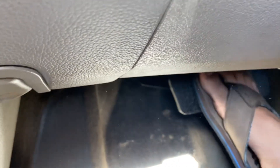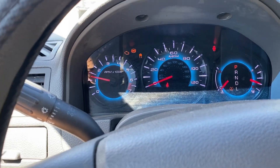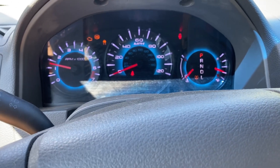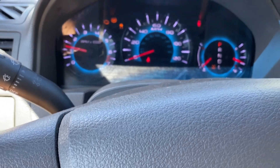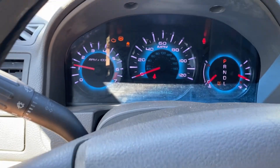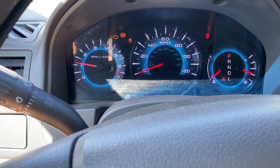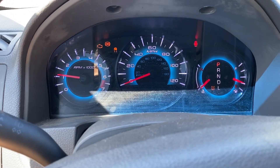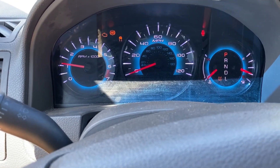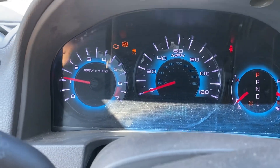As you can see, it goes all the way in and then right at the very end I can push and it barely brakes. I took some air out but it just wasn't getting enough air out of the lines. I changed the ABS motor, I also changed the booster, and I also changed the master cylinder. So the last thing it needs is having those lines bled. Probably the issue from the beginning was air in the ABS module. But at least now I have the whole brake system new. We're going to go ahead and bleed this ABS system with the tool.